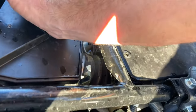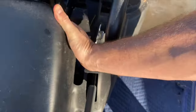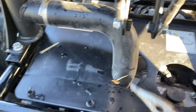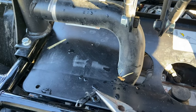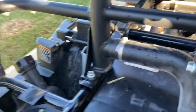This video is going to be a little shaky, but there's really no great way to put a tripod up because I'm moving around so much, so I'll try and keep it as still as I can. This is all behind the seat. Here's the engine oil dipstick, here's the spark plug, and the oil filter is down under here, as is the drain plug. The easiest way to access it is to take this panel off — rather than a screwdriver, just stick needle nose pliers under the edge of it and pop it up.